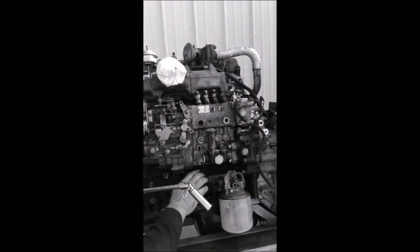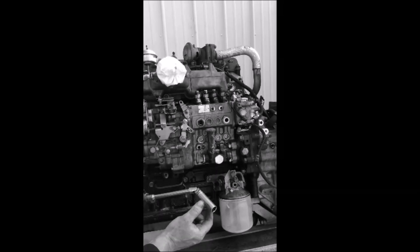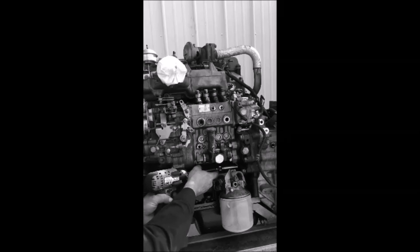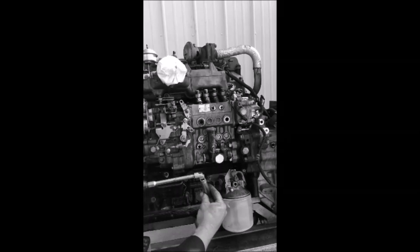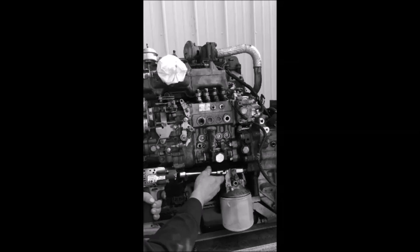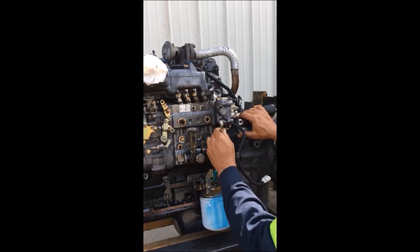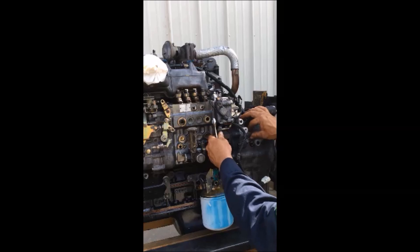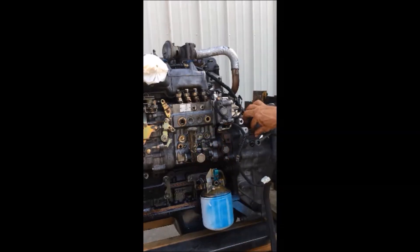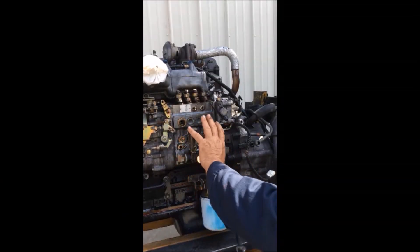The next step is to get the two bottom bolts. There's a nut and a 14 at the bottom of the pump — use a 14 socket, a swivel, and an extension. Get the bolt on this side too. The next step is the two set bolts: you've got a 17 bolt and nut; you may have to hold the back side. Take the nut loose, slide your bolt back. Once you get them out, your pump is ready to slide forward.